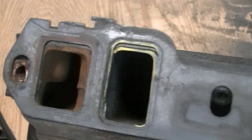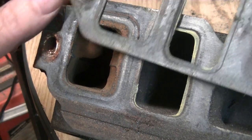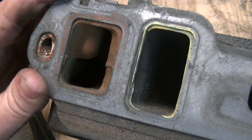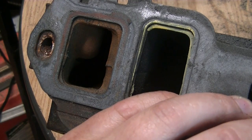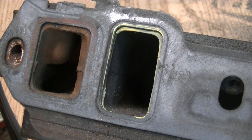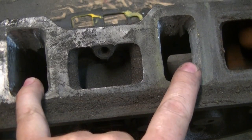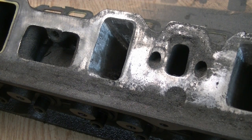The best way to line your gasket up that I've found is right here on the outside — there's a nice oval and you can get that lined up fairly easily. You can see the line on it, so that's where that gasket sat before. I got quite a bit of grinding to do on this one to make it smooth. I already have two done and I just finished the third one here, so I got one more intake to do. And then I'm going to do the exhaust side a little bit too, same thing to match the gasket.